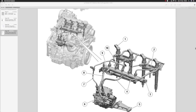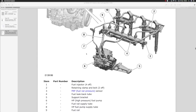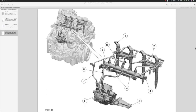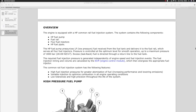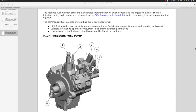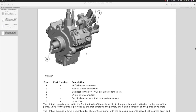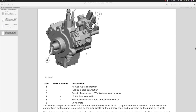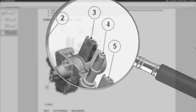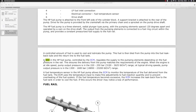Hello, welcome back to the Vehicle Repair Toolbox videos. What I have presenting to you here is the common rail diesel system for the Defender Puma 2.2. You can see that very clearly here. What we're interested in is the high pressure pump - basically this is supplying the common rail with pressurised diesel, unlike the old 300 TDIs in the Land Rovers. What we're interested in is the electrical connections - the VCV valve or the volume control valve, which is number three here. It's also been known as the MProp valve as well.